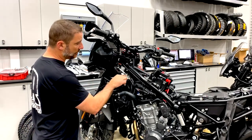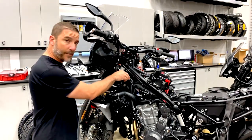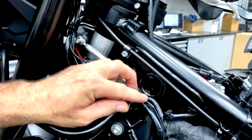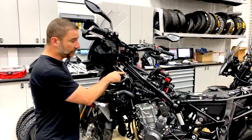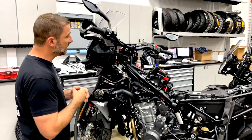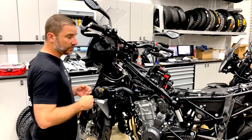So what we did is we created a brace that bolts to — there's basically a tripod of bolts right here — to a very solid mount. We've got a tie rod right here with a left and a right hand rod end, so you can actually draw tension on that bolt. That's one of the key areas that makes this thing so strong.